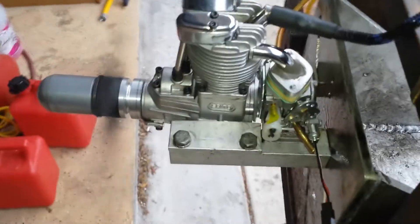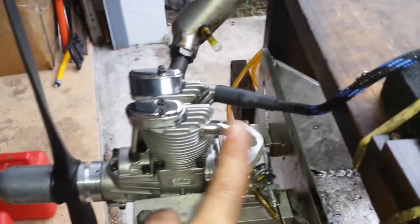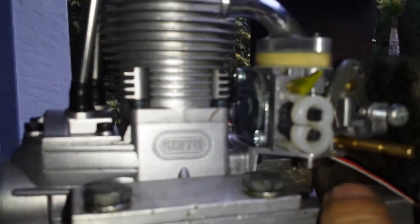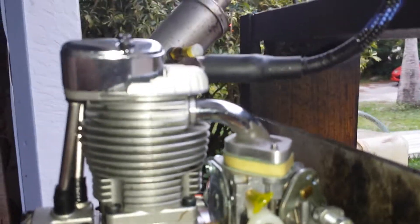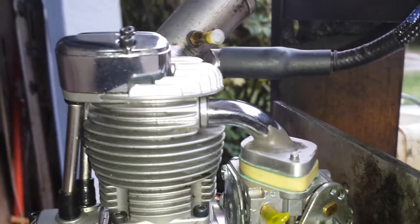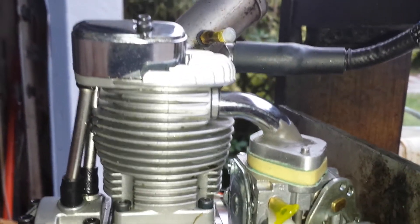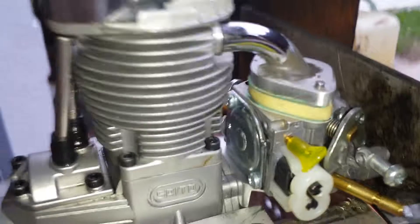One of the reasons is I will need to modify the intake manifold — cut from it — and pretty much every engine has to be done in place. Here we have the carburetor support, the regular Zama carburetor, and this is the part that pretty much I need to do for each and every single engine. I also have to add a little shim so it will seal pretty good. It's a kind of a hard conversion to do, but it's doable.